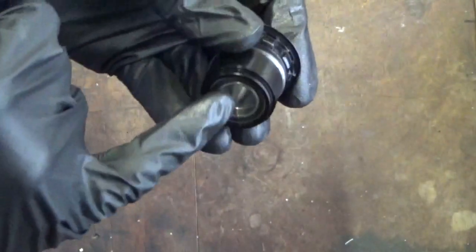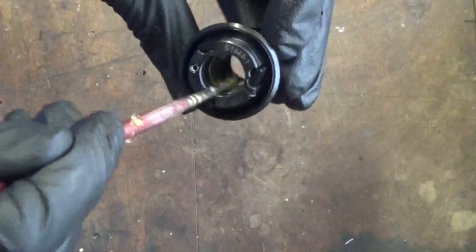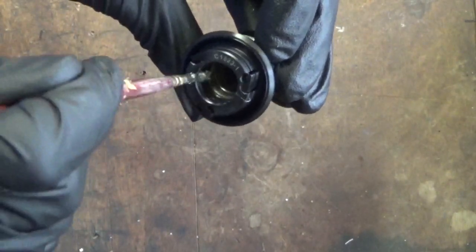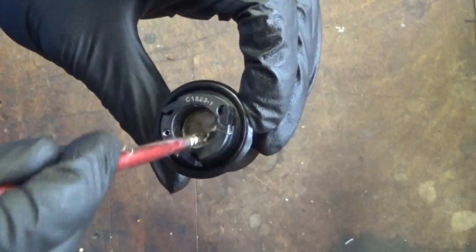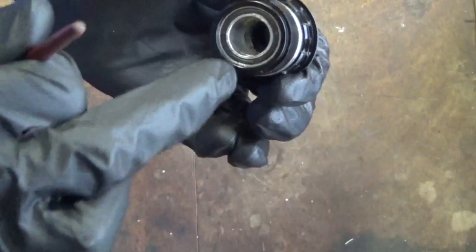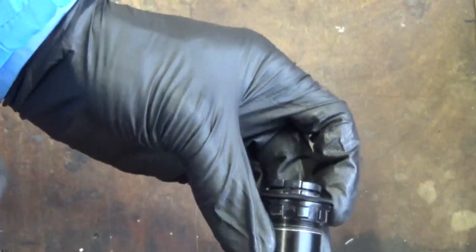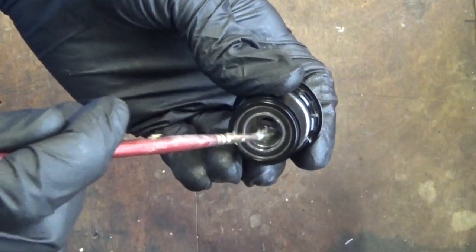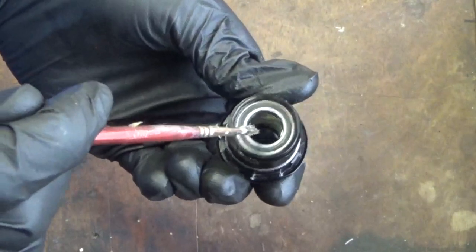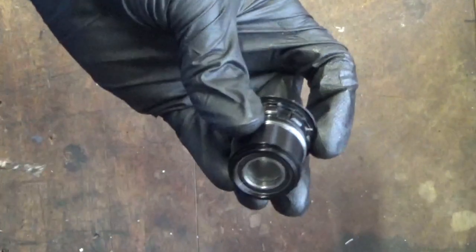and make sure that before you put this back on, you put some grease just on the end there, like so, and then also put some grease down inside the collar there, and make sure that the collar is lined up. If it's out of line just by a fraction, then when you put this on the axle, you'll wonder why it won't go back on. That collar's got to be lined up with the bearings. So make sure at the same time that's lined up, put some grease down in there as well. And obviously grease the shaft that's coming out of the wheel.